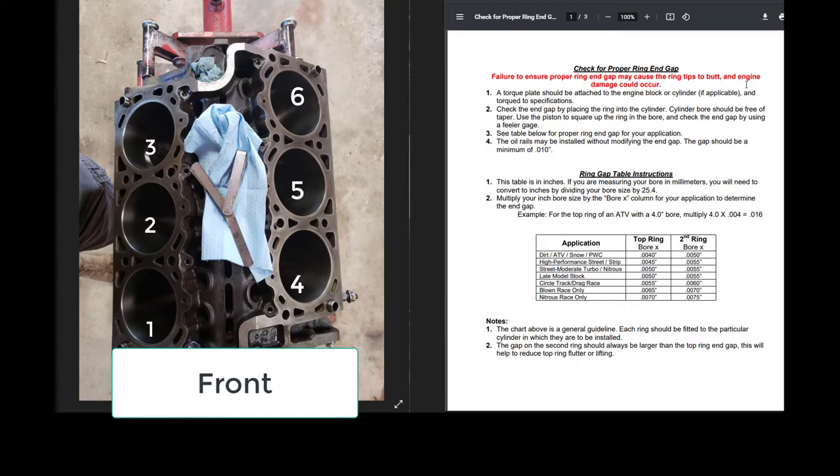I'm basically using this equation to get me in the ballpark, then I just open it up a little bit more. I'll put the link in the description. I'm putting the top ring at 23 thousandths, the second compression ring at 25 thousandths, and the oil ring will be roughly around 15 to 20 thousandths. That's pretty much what I'm doing with the ring gap, and now we'll go back to actually installing the piston.